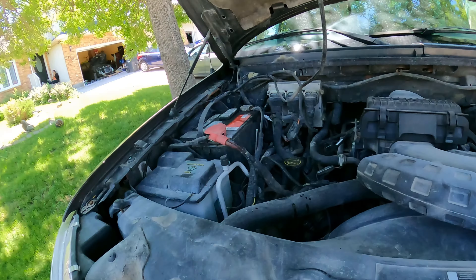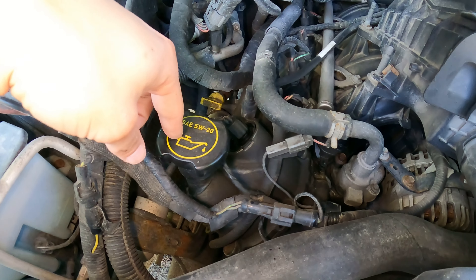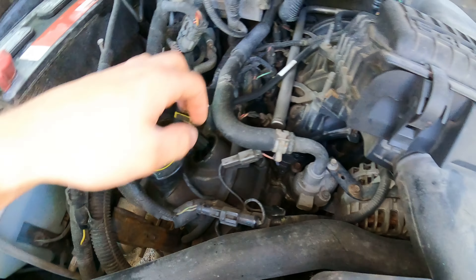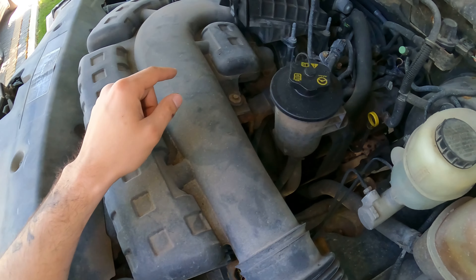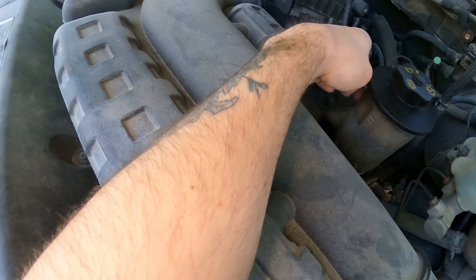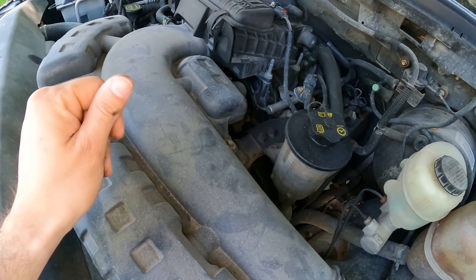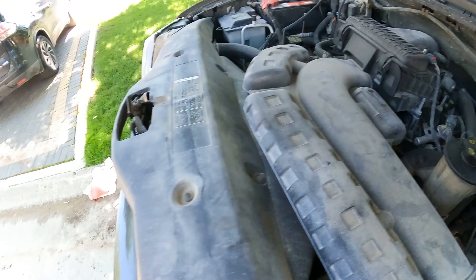I just put in seven quarts. Here's the part I'm talking about: you pop this cover off just behind where you fill up your oil, flip up the tab, and the whole piece pulls out after you unscrew the one screw. Same thing on the other side — you take this intake off and it's right in behind here. Those are the two main parts I replaced, plus other sensors, all to rule out phaser problems, which thankfully it wasn't.